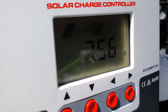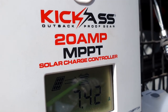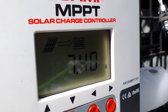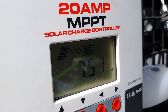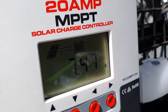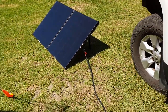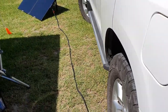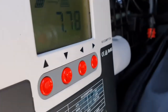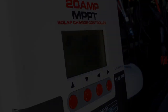Let's see what's going in now — can you see that? I've got this 20-amp MPPT hooked up to the car now because we're on power, and at the moment, with a little haze, it's got 7.5 amps going in. It's pretty good and it's still a little hazy. Just one last test — I have it rigged up to the old Prado to keep the fridge battery topped up all sun. That's about the highest I've had it — 20 to 21 amps. Highly recommend.